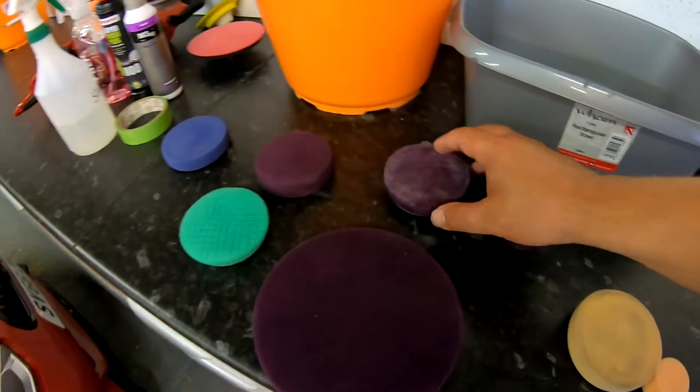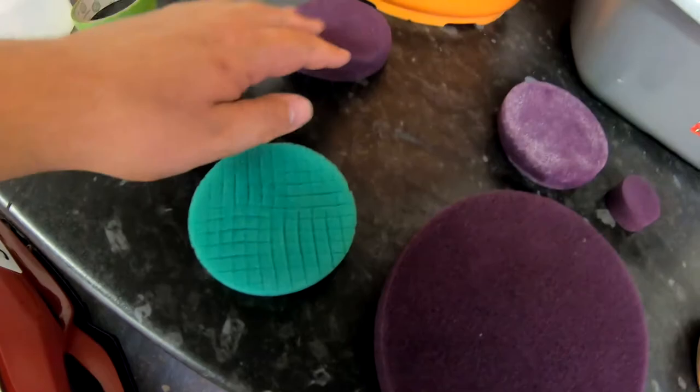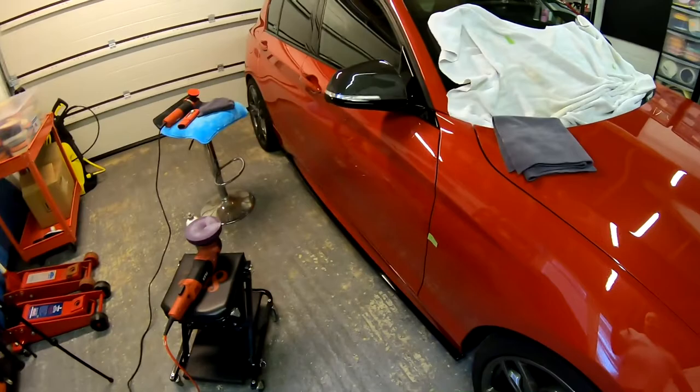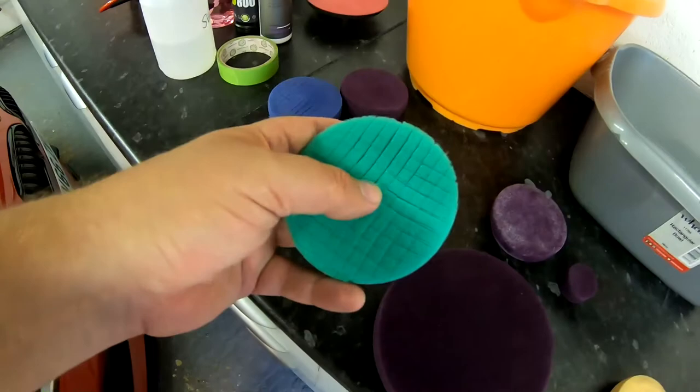Well, really, to cut a long story short, you can skip. People are going to pull me up on everything I say, but most often you can skip these green pads. You won't need to use these green pads for cutting most paintworks. And I'm doing my cutting here with those purple pads on hard BMW paint. And yeah, it's not easy, but the pad is fine, basically. It's never going to be that easy. I wouldn't really need to go up to this unless I'm really trying to pressure into deeper sanding marks. But even then, it doesn't make that much difference.